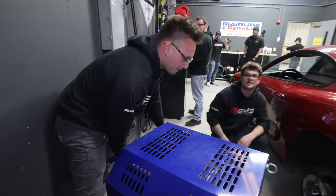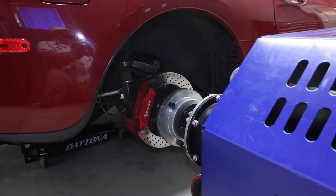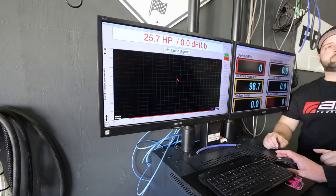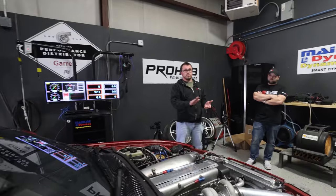With this hub dyno, does the car still need to be strapped down? In some cases the front might, such as super high horsepower cars, but generally no, not at all. I want to start slow — start at the lowest boost and start cranking up, maybe just by throttle. We could do a static RPM hold at 5,000 RPM, which would be a lot easier to control boost throughout the run — literally use your foot to control the boost with the throttle.